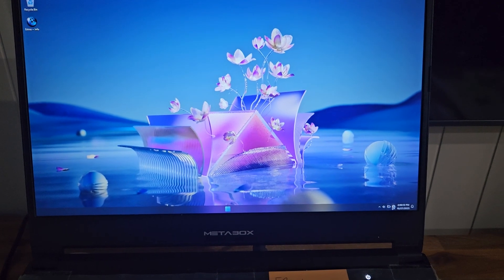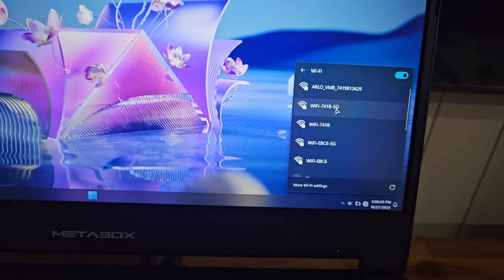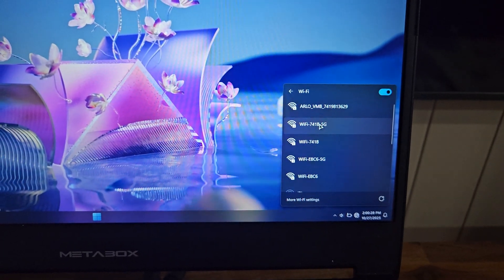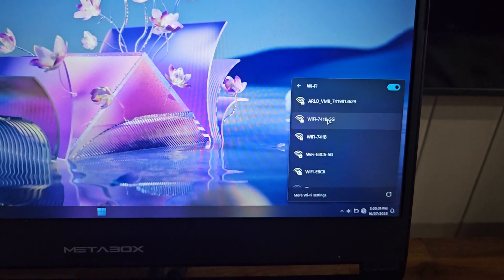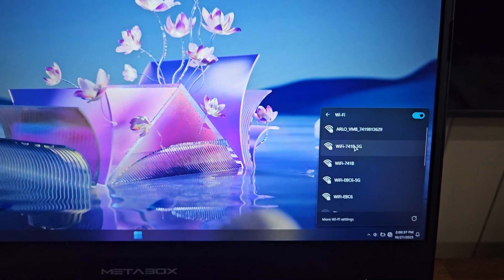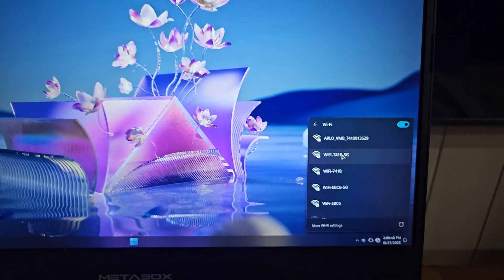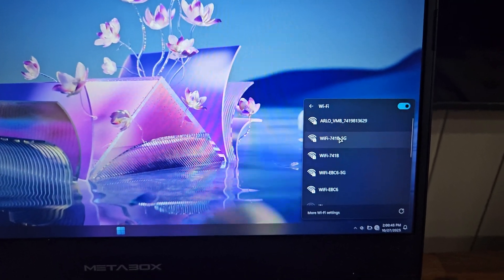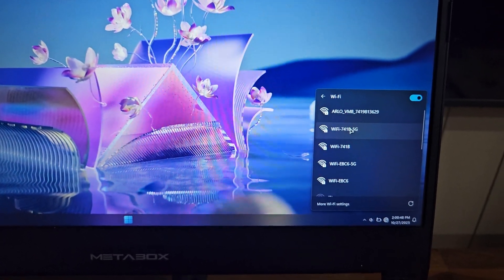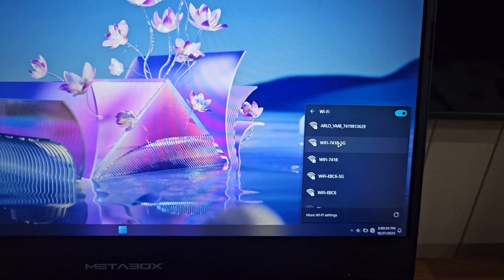I also meant to mention, down here in the taskbar there is no Wi-Fi. So you have to connect to your Wi-Fi before you can do any Windows updates. And the next thing I do when I do connect to Wi-Fi, I go straight to Settings, Security and Updates, and I run Windows Updates. That will install any missing drivers and whatever, just as it would happen on any Windows 11 installation. So I'm going to connect to Wi-Fi now and then we'll start.